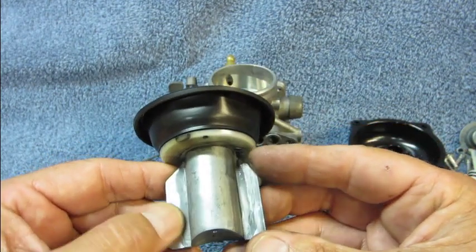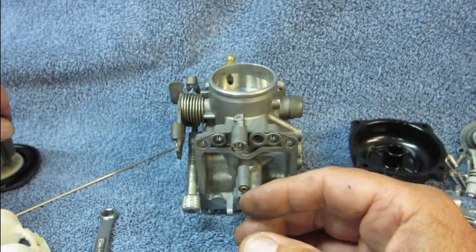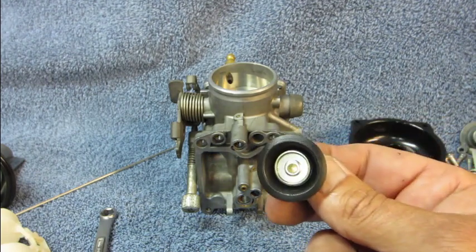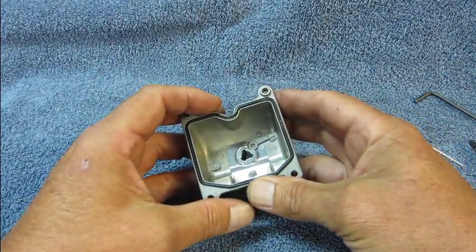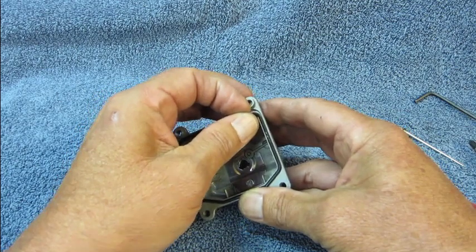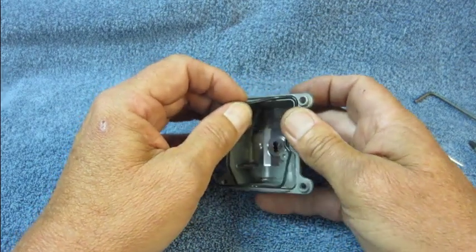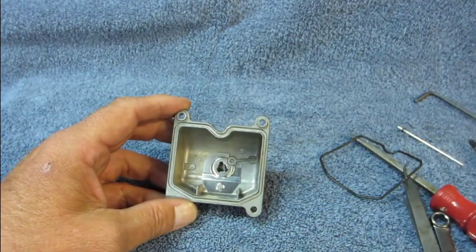This diaphragm doesn't need to be dunked in anything to clean it — it can just be wiped down. If you're going to put rubber in any cleaner, make sure it won't be affected. Same with this little diaphragm assembly. The one rubber part we don't want to overlook is the gasket that's in the bowl. Before we put the bowl into any solution, we want to get this gasket out — it's oftentimes a little stuck. Carefully pry it out of its groove without any metal tool so you don't nick it. Then you can go ahead and put the bowl into the solution.